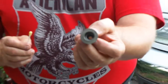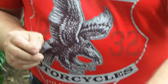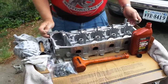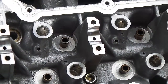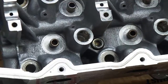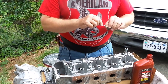Take a good look at the seal — there's a rubber insert, you can see the gray area on one side. The valve stem guide is dry right now, so we need to lubricate it. The guide is kind of made out of brass or copper. The seal fits right over the stem guide just like that. Since it's a dry stem with a dry seal, we're going to dip a Q-tip in some motor oil and give it a light coat. Don't overdo it — just keep it easy on both sides.